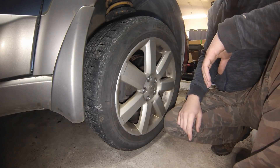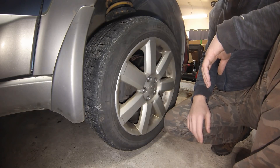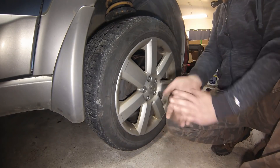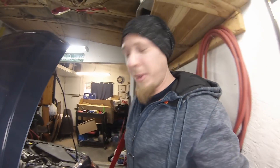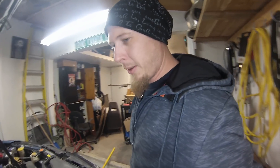I'm assuming this caliper is seized up, but I'm going to take off the wheel and make sure it's not just a slider issue - though with the amount of resistance on it, I highly doubt it. We'll have to think about getting a replacement caliper and getting it on there so it doesn't do that anymore.